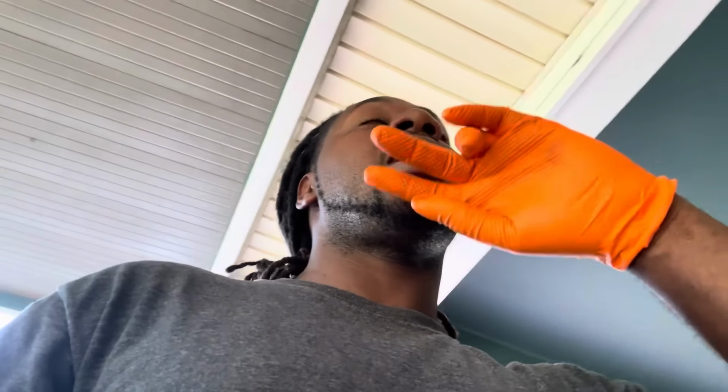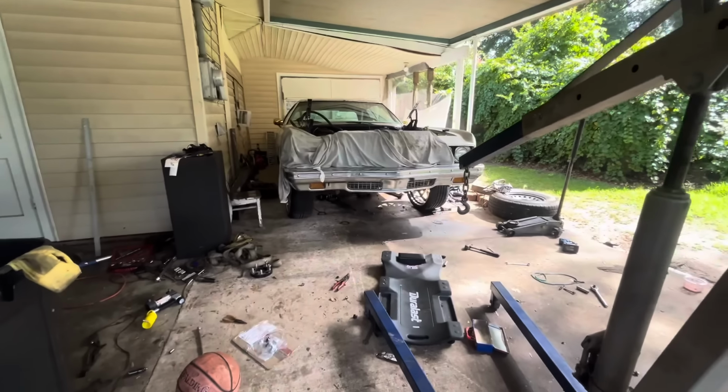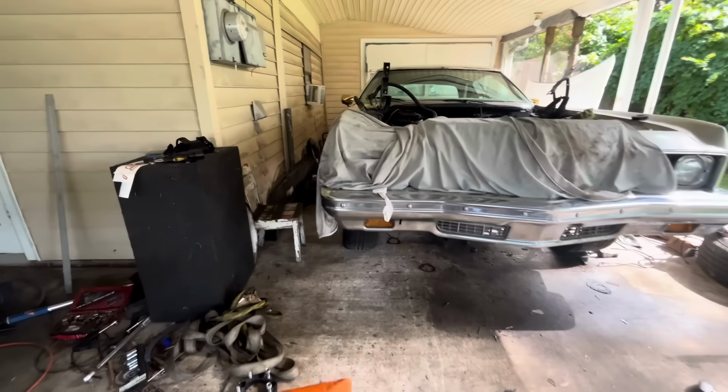So guys, my plan is, I asked my guy, I think I probably put this in the video. We're gonna have to get a bubble Chevy or anything round body fuel tank for the dump. How I'm running it, like I said, I'm running an internal fuel pump in the tank. I might have to get some more gas lines. I was thinking about using the lines I have since they already ran through the car. If I don't do that, I'm gonna have to get under the car and trace the gas lines. That's what I'm probably gonna do.